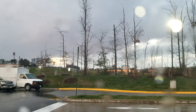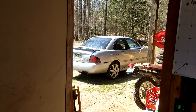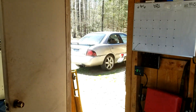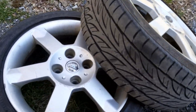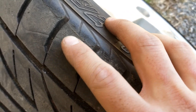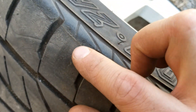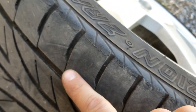Well, it was a successful track day, but it ended like this — luckily it stayed dry the whole day. That stop sign was about to fly off the pole a minute ago. The last thing we're going to do after the track day is a nut and bolt check off camera since that's pretty extensive, then take these wheels off and put the daily driver wheels back on so I don't catch a nail on the way to work with these higher-performance-ish tires. You can see the difference between street and track driving — the very edges of the tires on the street don't get touched, but over here you can see the line where the track edge was used from the extra cornering force, and there's a lip from the tire being scuffed hard from a little understeer and then smoothed back out driving on the street.